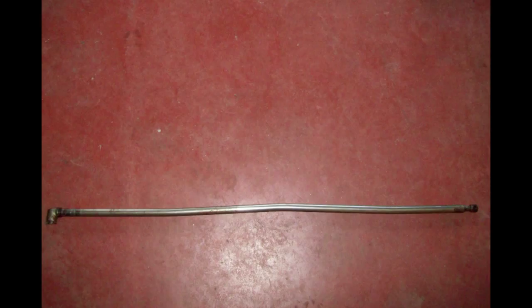There is a video on YouTube by Boosted VW that shows how this is done, but I would do it a little bit different. I would pull this shift tube out by running a wire all the way down the tunnel from the front and looping it around the shift rod tube, or wire tying it with a wire tie. If you wire tie your wire to the shift rod tube and bend a little crook in the end of it, then you can pull that shift rod tube out far enough to install the new bushing.